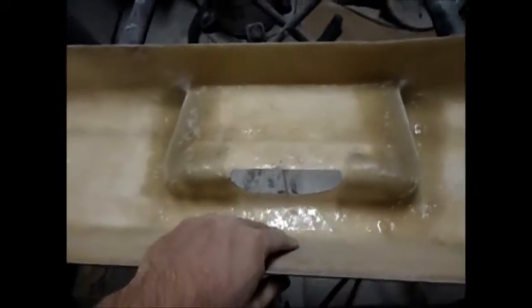Way too thin - I mean, super light as a feather. The first person that taps your car from behind, this thing is going to be falling off from the thin mounts. At least he did put a little bit more on the mount - it looks like he put one layer more. You could actually see the line where it is. But even then that's still not thick enough. I feel bad for anyone that bought this bumper. There's the headliner again - that's about the thickness. That's the thickness of the mount. You'd be lucky if that's two layers of glass there. Come on - get some X-MAT. It's not that expensive. Throw some X-MAT in there, that's what I did. Mount will never break on you. But yeah, this thing is just ridiculously thin. I'm just amazed at how thin it is for a rear bumper.